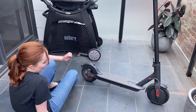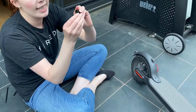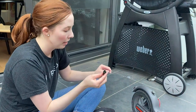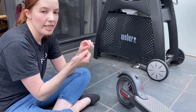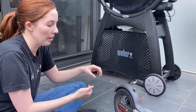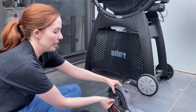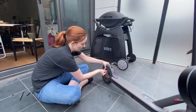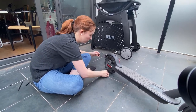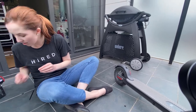That part is straightforward, but the next thing you need is the cap off your slime bottle. The inside part of it is a little tool that helps you get the inner valve thing out. Inside this valve there is a little valve that stops all the air getting out when you take the cap off, but it actually prevents the slime from getting in. So you use this tool to unscrew and pull that little valve out — and we'll put that somewhere safe so we don't lose it or it doesn't roll away.